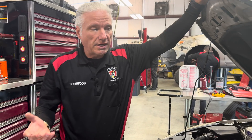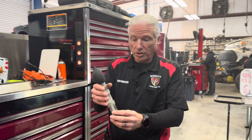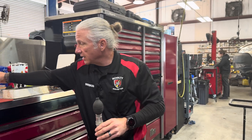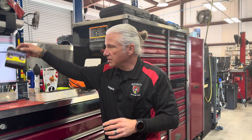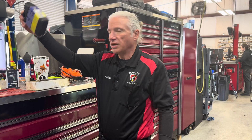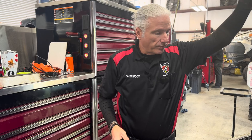So that's three ways to test a blown head gasket. I know a lot of you guys are going, oh man, that's crazy to use a really expensive piece of equipment for a blown head gasket. But here's the thing — sometimes, even though the chemical tester is really accurate and works good, if it's a really slightly blown head gasket, you might have a tough time picking it up with that. But we will pick it up with the five gas, and we will definitely pick it up with the CO2 detector. There's pluses to them all. We're not talking too much money, and this thing will do dozens and dozens of head gasket tests. I used this chemical tester for many, many years, and then we got the CO2 detector, and now we've got the five gas. There's a place for everything.